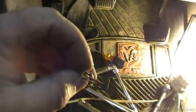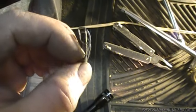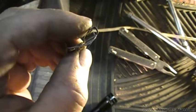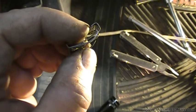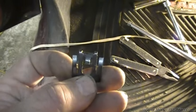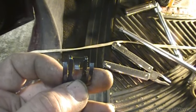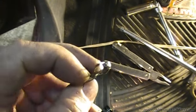I want to give a close look at this clip — this is what's on the clutch pedal. It's kind of hard to describe. The way you release it is there's one tab on the back side that will have to be lifted so the actual pedal pin will pass under it and you can pull it out. It's kind of a bugger to reach up in there with all the wiring. Just take a small screwdriver, have some patience, and don't pry real hard because you don't want to break it. Once you lose that clip off the end, you'll end up hunting for a new one.